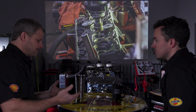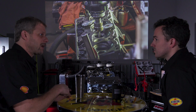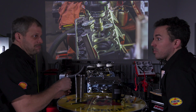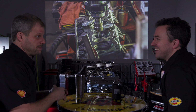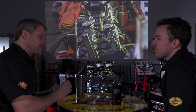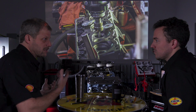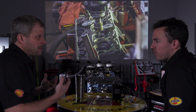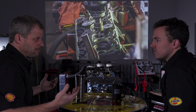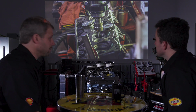And really what's found is when you go through and you lap it, no matter how much you clean it, you still have lapping compound in there. That ends up basically diamond dust, and it adds wear to the seats themselves, whatever's left, and then also into your guides. So it goes everywhere at that point. Yeah. So if you don't need to lap them because the cutters are better, you don't bother at this point.